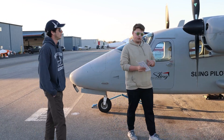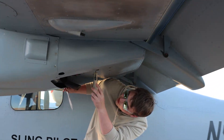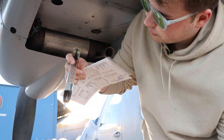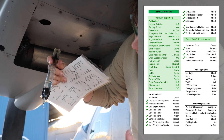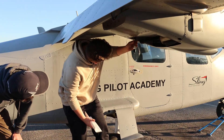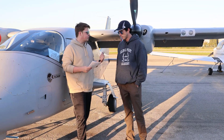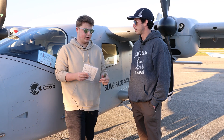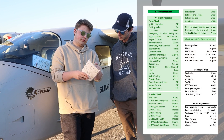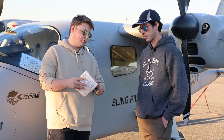Now that we've checked the oil, the last thing before double-checking our checklist is to sump some fuel. For the fuel, we're going to come to the back of the engine here and find the little fuel sump. We'll pull it out and double-check for no contaminants floating or sunken at the bottom, and look for any water — this looks pretty clear. We'll do the same with the right engine: grab a good little bit of fuel and look for the same thing — nothing floating around, no water in there. This side is also good. Now we'll run through our checklist to confirm everything: left side of the plane completed, gear pump, battery box, horizontal tail and trim tab, vertical tail and trim tab — all checked. Then the right side as well. Everything on the exterior check is complete. The pre-flight is done and we're ready to go fly.